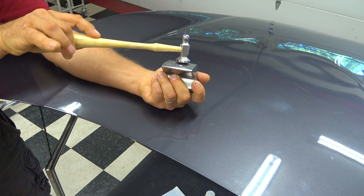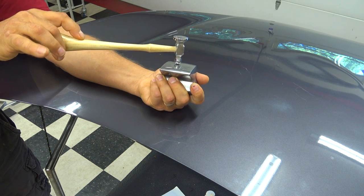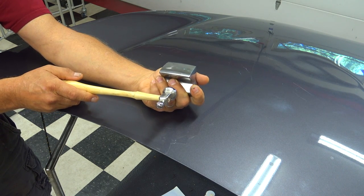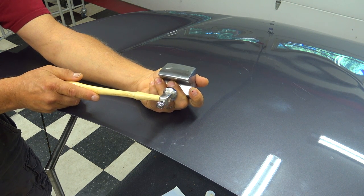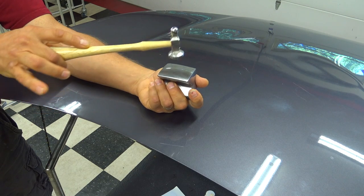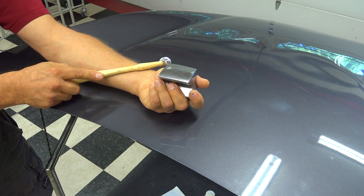Eventually we'll go to the advanced techniques using either side of the hammer. Hammer and dollies are something you could spend at least a couple of weeks on; if you're doing the Fairmont method it'll take about three to four months to really master them. But they move metal like nothing else and finish metal super fast. Especially when ironing out cottage cheese work in cookie repairs — if you can get a dolly back there and iron that metal out, your cookie repairs go so fast it's almost ridiculous.